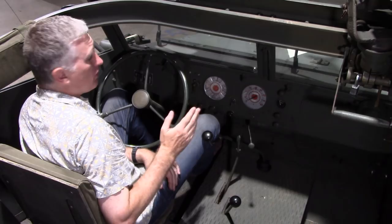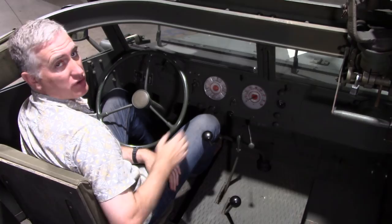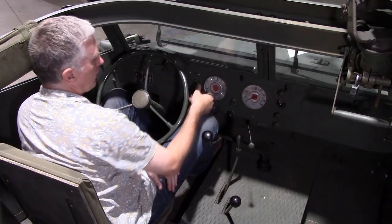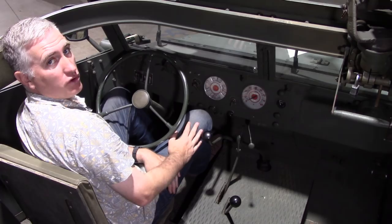The original ones had an in-and-out with various stops depending on how far you pulled it out and how bright your lights were. In this one, you've got four sections. To go to blackout marker, you don't need to do anything, but to do anything beyond that — say you wanted to go to full service drive — you have to push this release button. It stops you from accidentally knocking it as you're driving off-road at night, sneaking up on somebody, accidentally hitting it with your knee, and — oh look — you've just illuminated yourself to the world.